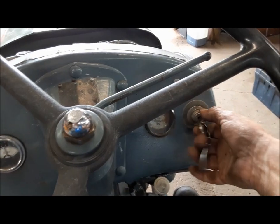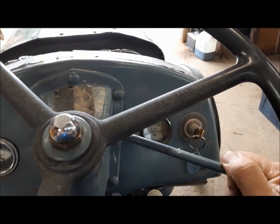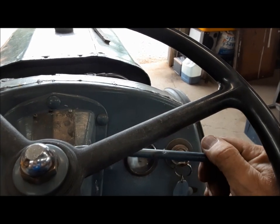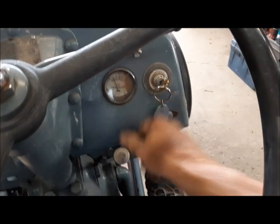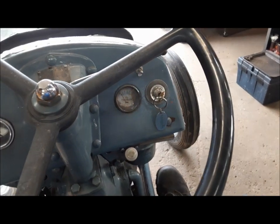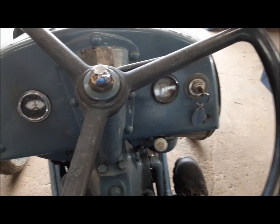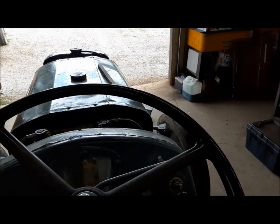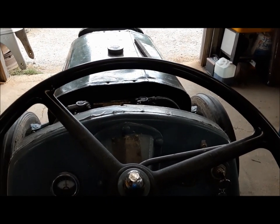Here's what she does — choke on. That's all we get out of her. She's just hitting on a couple of cylinders, and then she quits. So there's a few things we're going to try — just cover the basics first. We're going to double-check the fuel flow. I'm going to bypass the fuel system completely and go with a little auxiliary setup I've got made up, and try and run it that way to make sure that's not the problem. We'll go through it step-by-step until we get to the root of it.